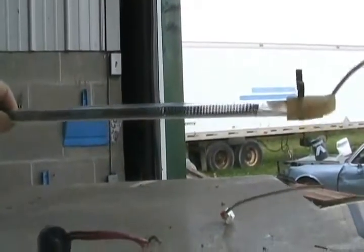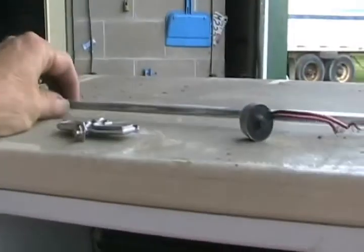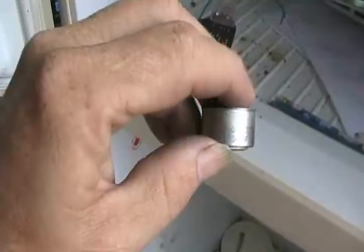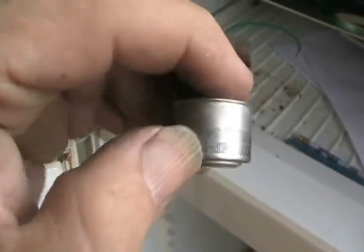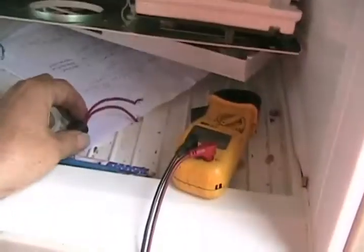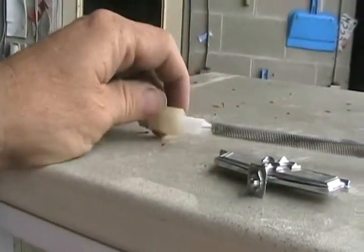These heaters have a resistance of anywhere from about 10 ohms to 40 ohms. Side-by-side fridges that have the freezer on one side often have two shorter ones, each about eight inches apart, so one may be good but the second one may be bad since they're wired in series. If you have the heater tube that looks like the black one from a stove element, those ones most rarely burn out. When replacing defrost termination thermostats, it's important to try to get the new one close to the larger number. You can't tell when these are burned out by looking at them — only the meter can tell you. Sometimes you can tell when the glass tube ones are burned out if you see the little coil inside has snapped or burned off.